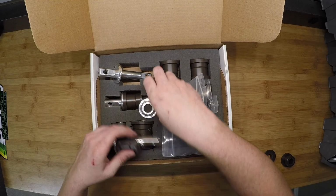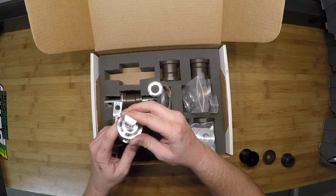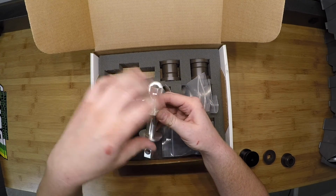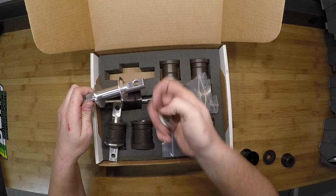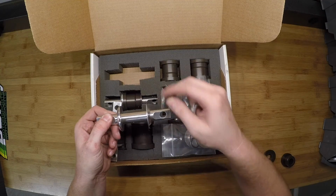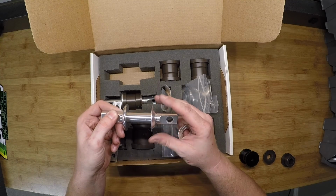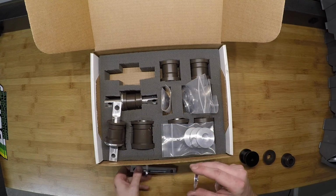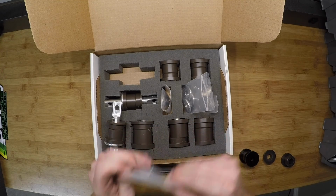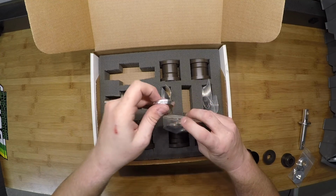For the non-offset kit, I have a full-size washer since it's easy to machine and doesn't involve a lot of separate structure on the dog bone. But to fit inside the subframe, it's a pretty tight fit. So it is fairly thin here, but it is strong enough to do what it needs to do. That will come in a bag in this location for the non-offset kits, standard Delrin and Delrin AF. And then the small washers go in here.